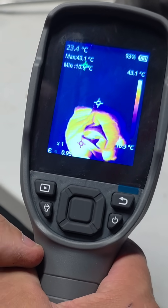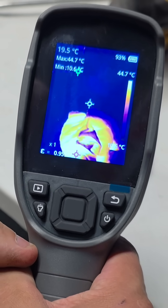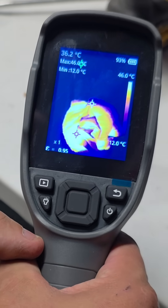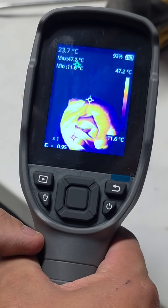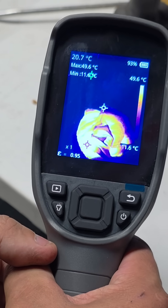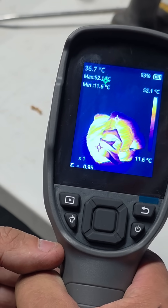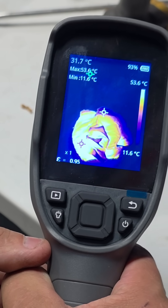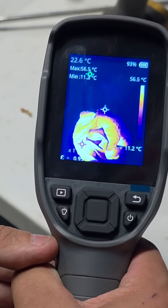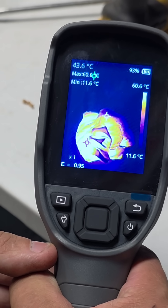Look at that - 42. How hot do you think car body filler will get? All we've done is mixed it up like we normally would and just stuck it into a rubber glove. Look at the speed of how quick that is getting in temperature. We're at 50 degrees in that glove. 52 degrees. 53 degrees. 54. 56. This is really going now, guys. How hot will this get to?